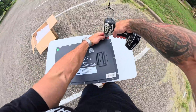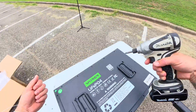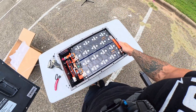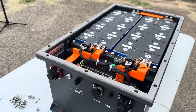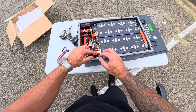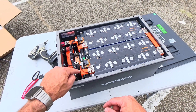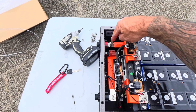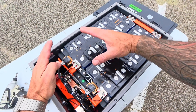That's how the battery comes in the packaging. Let's take the lid off — I want to see what it looks like on the inside. Opening the lid for the first time. Look at that — the battery is made up of individual cells tied together with bus bars that run across. You can see the positive and negative sides. These bars are custom-made specifically for this battery. Sometimes you'll see a battery with just a wad of cable; this has proper bus bars. They also left a little slot so you can move things around to adjust for where the cells line up.